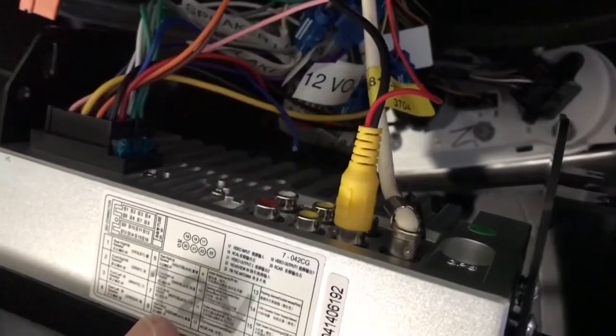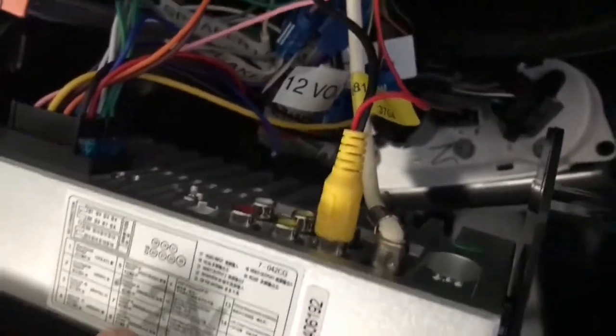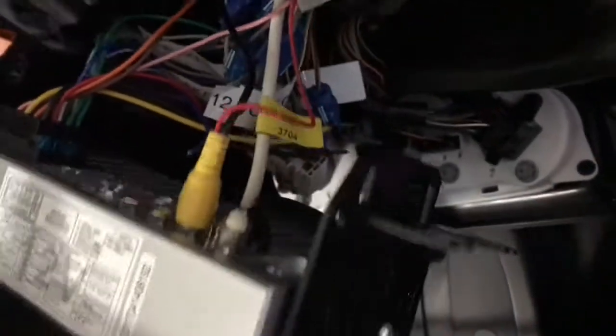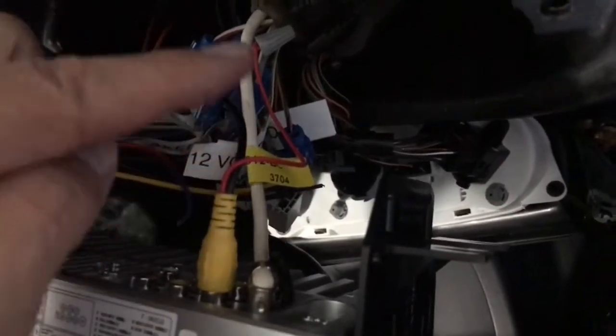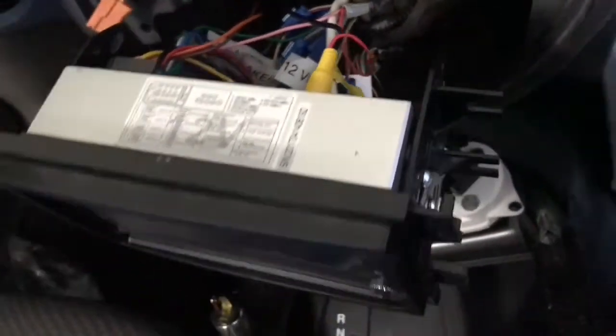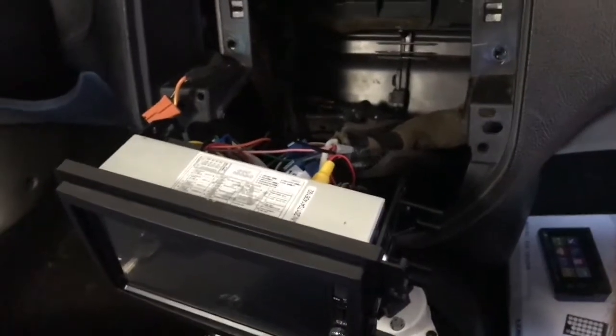All right, I've plugged both wire harnesses in. I also plugged in the camera in, and also that red lead goes to the camera in. The red lead goes to the pink wire over here, and I have a wire nut right there. So I'm just going to put it in place, put the 4 bolts back in, and make some more tests.